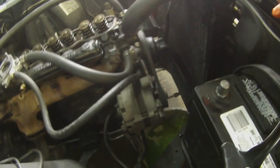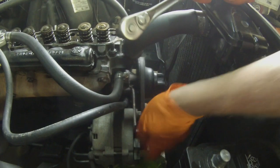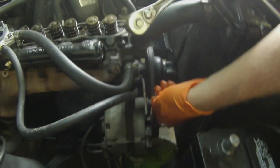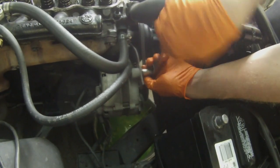What I'm going to be working on now is just getting clearance between the engine and the radiator. I'm going to take off the belt, take out the fan, and remove the radiator. For the alternator, rather than disconnecting all the wires, I can actually just remove the alternator and let it sit right here. That way I'm not messing with those wires at all — that'll all stay the same.